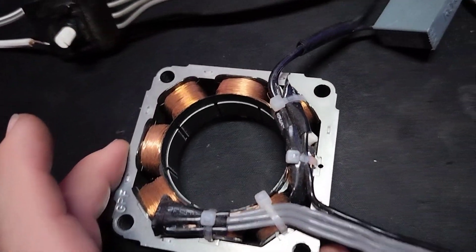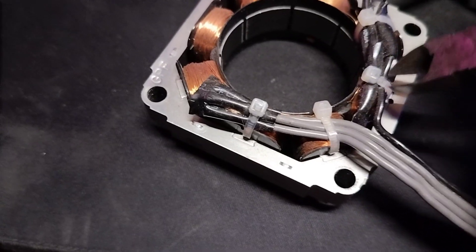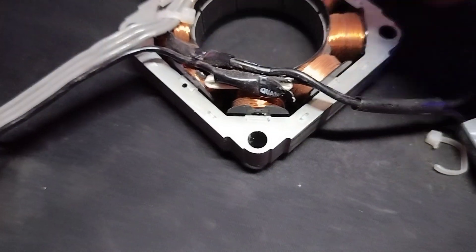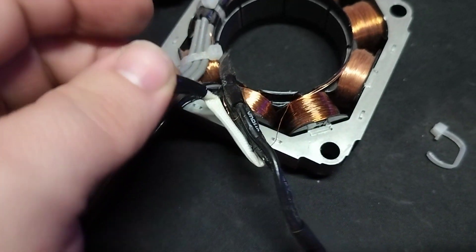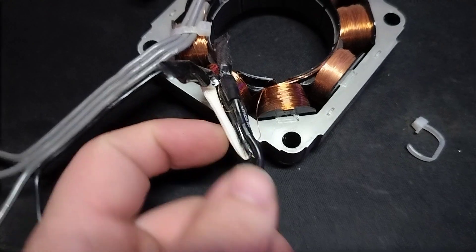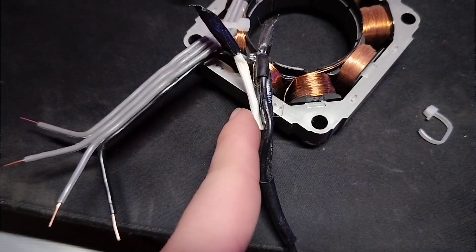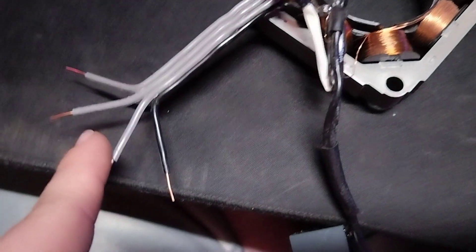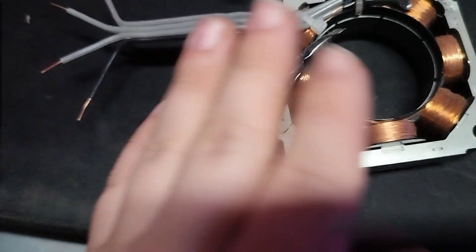It's hard for me to explain because I'm learning this as I go along. This is kind of a sacrificial motor, but I will be using it for something else at some point. If you want to replace your thermal fuse, it's right there inside this little fiberglass sleeve — that's your thermal fuse. That fuse just goes through this black lead right here, which is your common. The wire next to that is your high speed, medium speed, low speed respectively on a Lasko fan motor — any Lasko fan motor.